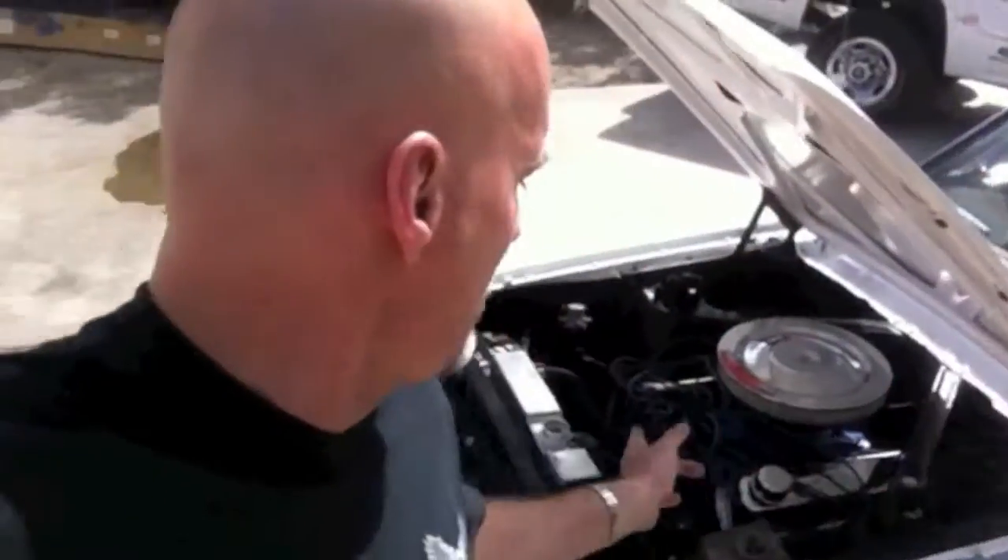It's time for the first test drive. I'm going to go pick up the kids at school and bring them back in the Mustang. Checking all fluid levels — needed more fluid in the power steering pump, which is making some noise. I put water in the radiator so that's doing better. What's happening now is all the paint is burning in as she heats up. I'm waiting for that fan to go on. This part's always kind of scary when it starts smoking, but it's really just burning in. The paint is heating up on the manifold for the first time — this residue will burn off. It's probably just a slight film of oil, but I don't hear any exhaust leaks whatsoever.